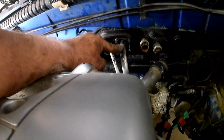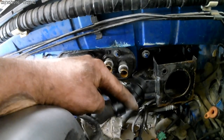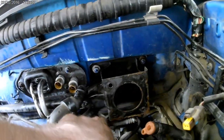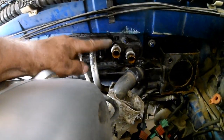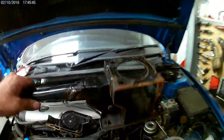These two pipes - the two hoses for the heater matrix for the cabin - are already out. So the next job is to take off four bolts on this end and two bolts there, and I'll be able to pull out the tube. But before that I have to remove that rubber cover, which is held by five nuts or six bolts. And that's the tube out.